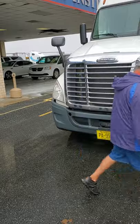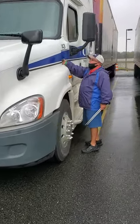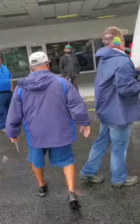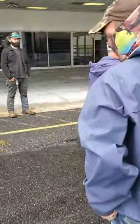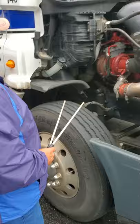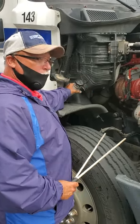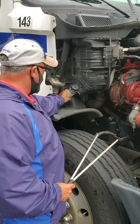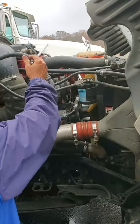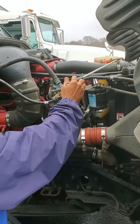I'm going to raise the hood. Going out the base this side first. It's a Cummins engine. Before I miss it, I'm going to say something about my windshield washer fluid — make sure it's not leaking, accurate level. I'm going to come to the top, check all my hoses, make sure they're in tight. No bulging, no cracks. Clamps are in place.